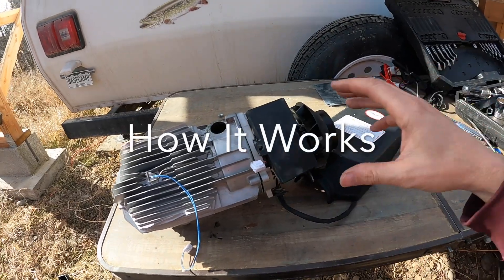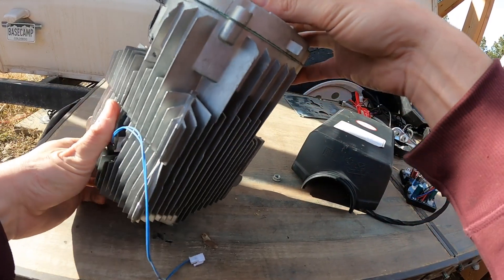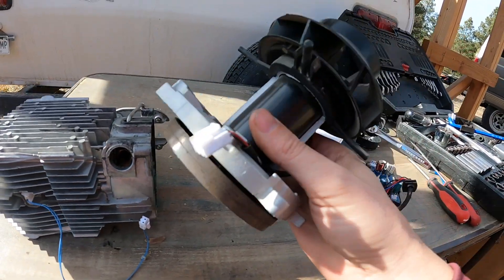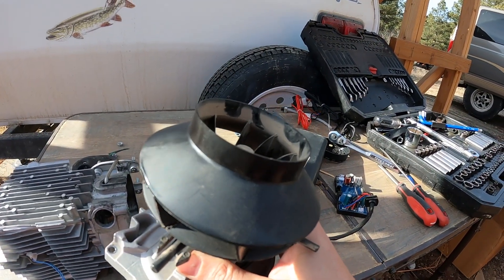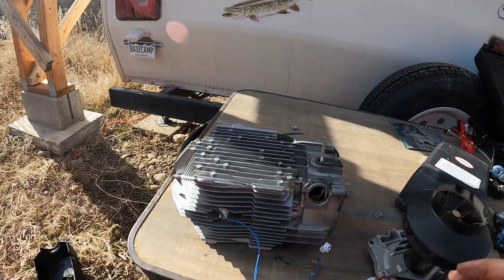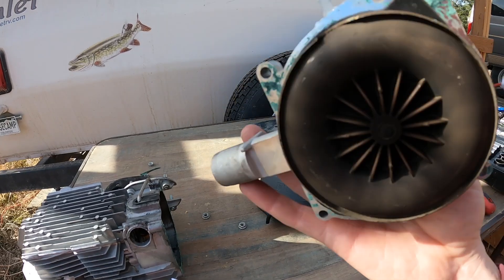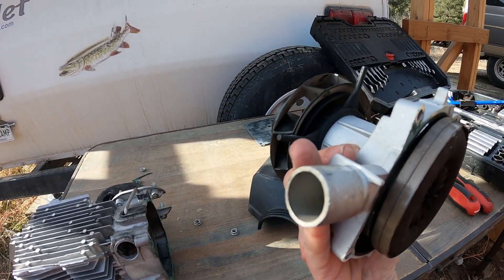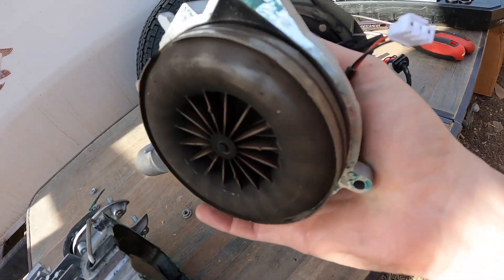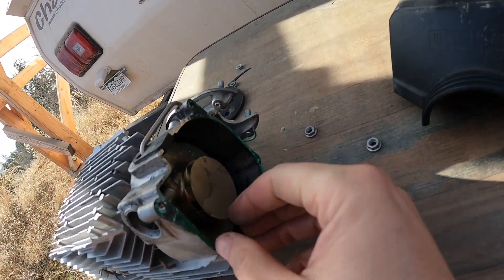Before we get into adjusting these things, this is just a strip diesel heater so I'm going to show you how these work. Once you remove the control board, you're going to take out some five millimeter allens here and this is going to separate the fan assembly. You have a fan here that's responsible for blowing air over the heating fins and into your van or shed or whatever. The fan in here is actually the mixture fan — this is the intake for the combustion, air comes up in there, and this fan blows the air into the combustion chamber.